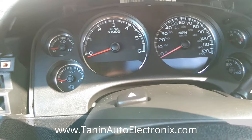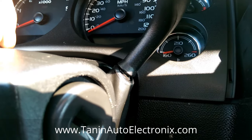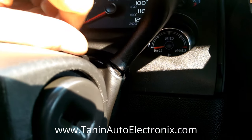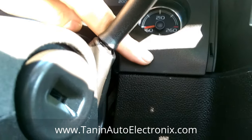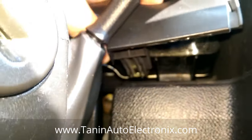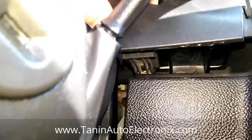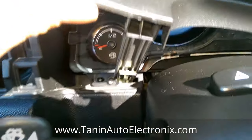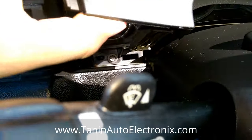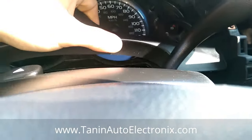In the next video segment we'll show you how to pop this trim panel out, but again it's just clipped into the cluster. The best way to get this trim piece out is to insert a flat blade tool right around this area and then pop straight out. This long piece right here has a clip on the back which clips into the cluster, so that's where you need to pop it out and pry it out of there. Same thing on the other side — there's a long clip that goes into the cluster, and then you'll see the screws on the bottom. The top will just pop right out easily; you probably don't even need a tool for that.